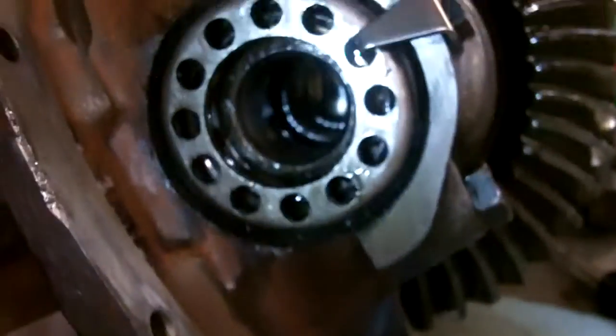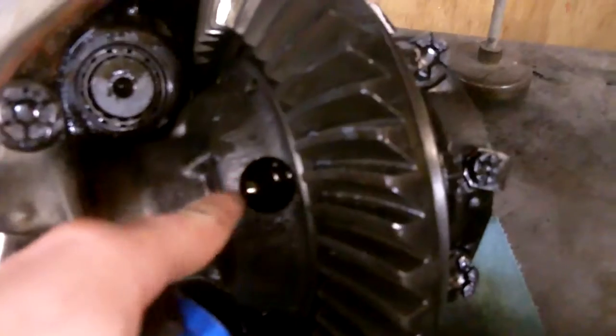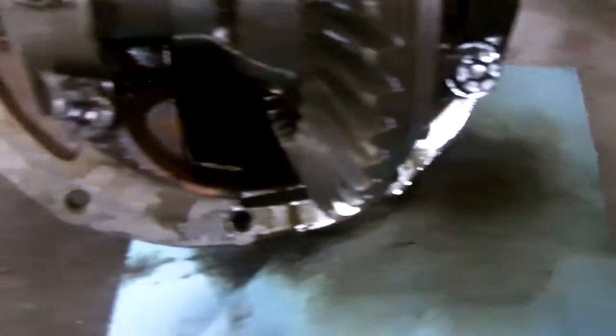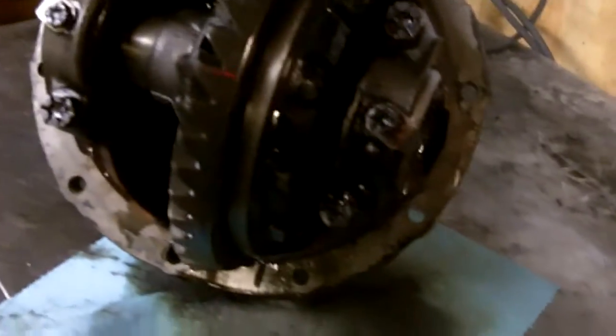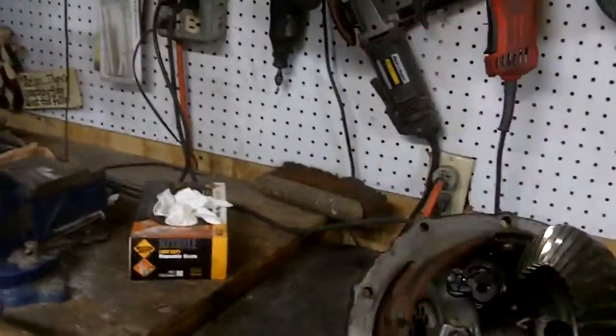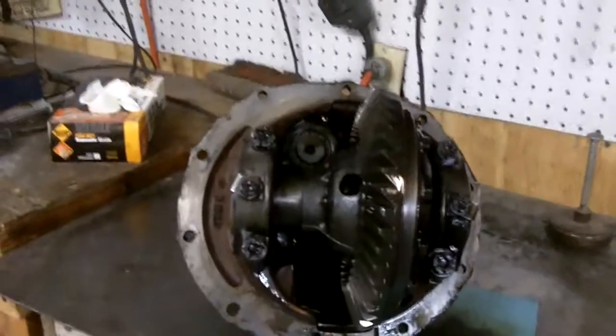Let me think here — yeah, this is the proper side. What's funny is the axle that was good came out of this side, but the splines in there — you can see the internal splines on the inside. We'll put this in faraway mode. See the splines in there? That whole sleeve with those splines and this gear that's sticking out — that little tooth right there, you can see it — all wiggles like crazy. It's not stationary at all, and I'm pretty sure it ain't supposed to be like that. When I cracked this loose from the housing, there were bands of thick silver goop coming out — that was metal filings, steel paste basically, mixed in with the gear oil.